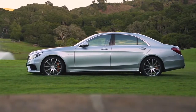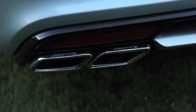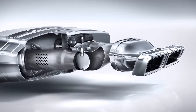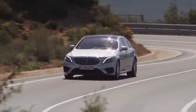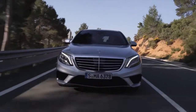Because the S-Class is a flagship ultra-luxury vehicle, you want to show the amount of power, and part of that is the exhaust note. AMG is famous for their exhaust with that quad tip, and the beautiful sound that comes out of that engine — but you don't want it to be overbearing. What's new for the S63 is a variable vane inside the exhaust system. Based on the load, it can manipulate the exhaust sound. When cruising on the highway you have a nice mellow tone, but when you put your foot to the floor it opens up wide and gives you the full exhaust note — and everyone knows that's an AMG.